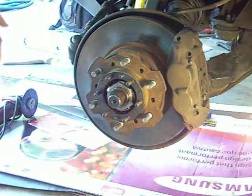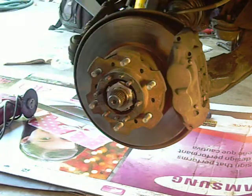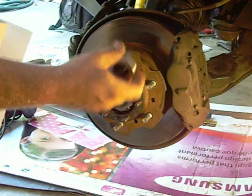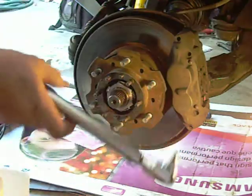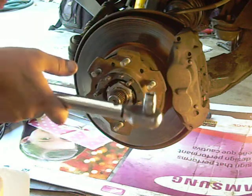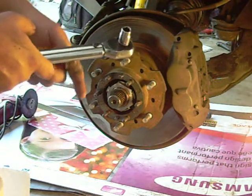I have everything ready. Lightly grease the cone washers, have paper towels ready, have some tools here that make the job a little bit easier — I'm showing another member that was over here yesterday. This is a great tool to just quickly dial things in and get them snug, then finish it off instead of turning the wrench. You're going to need a torque wrench, 3/8 drive, and you're going to be cranking these down to 21 to 23 pounds on the hub body-to-hub assembly with the nuts, washers, and cone washers.